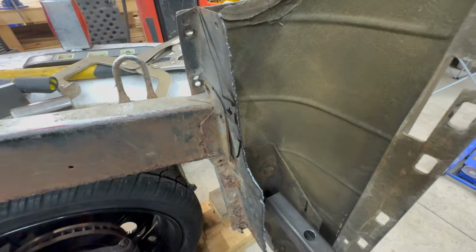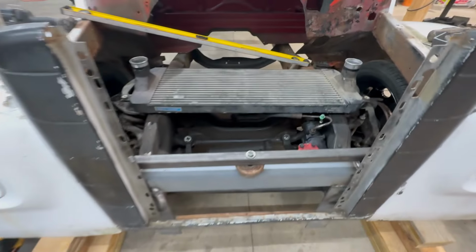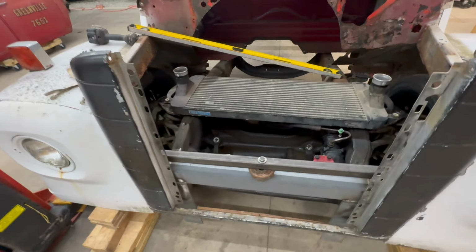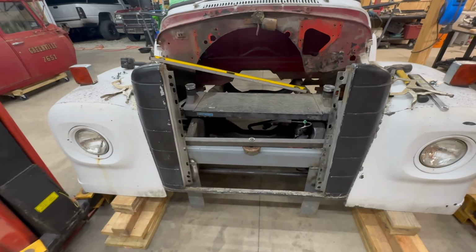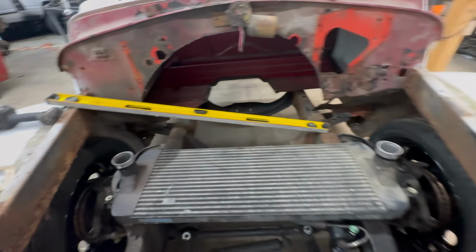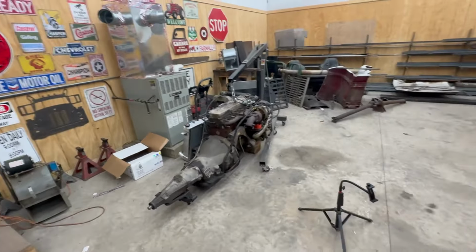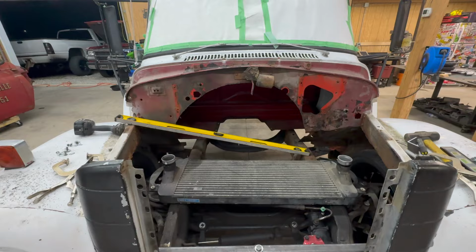So we're gonna take those pieces out and get them trimmed up and put them back in, and then get those little angle pieces welded on the corners so this front end is being held by this center mount there, and then we'll get the intercooler dropped in and get it attached to that side like I just showed you, and then onto the radiator, wherever it ended up. There it is. Get it in here tonight and set the hoods on and make sure everything's happy.